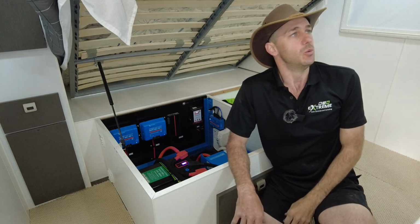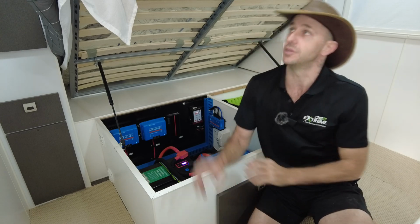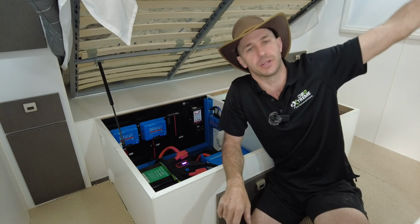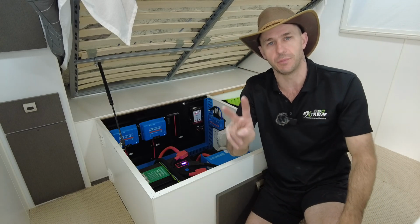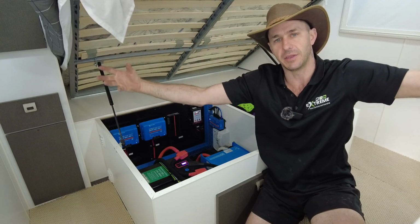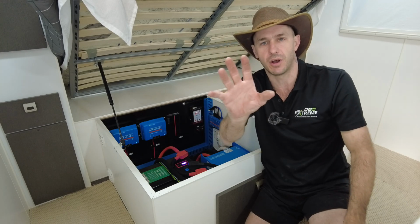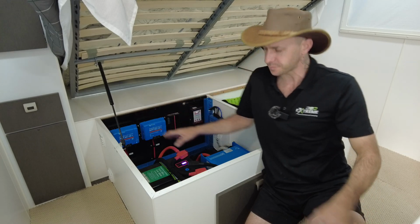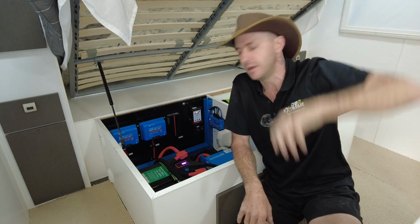So we've added another 4 150s. We're able to squeeze in 4 150s: two more up the front, another at the rear, and another one dog-legged through the center here. We've split them into two in series, two in parallel. Two are tied in series away from the shade, another two in series, and then brought down in parallel into the 150. So there's 1200 watts of solar, 600 going into this one, another 600 going into this. All individually controlled. You can see each array's yield up on the touchscreen.